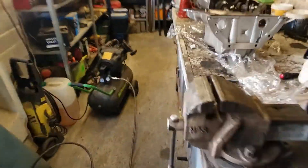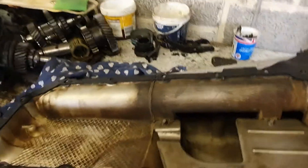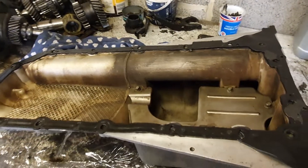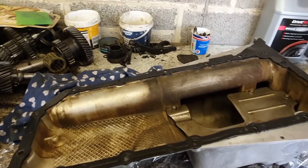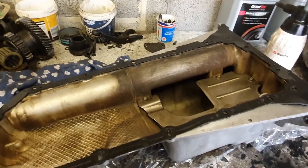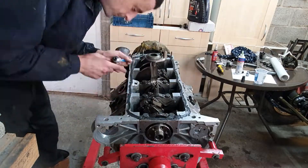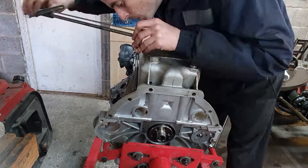Right, I'm onto the sump now. I've cleaned it up. There's a new sump gasket but it's wrong, so I've had a look at the sump gasket that came off and it's pretty good - I'm going to reuse it. It has some thickness to it and substance; it can't be crushed down too much. So I'm going to use instant gasket on there - not too much like the previous owner. I'm also using a proper RTV which is going to dry and then won't be dissolved by the oil. This sump took some cleaning - there was probably half a pint of sludge in the bottom. I took the windage plate out and lock-tighted those bolts back in. I also found the missing 13th bolt for the sump pan. So a very thin layer of sealant on there, sealant already on the sump on the other side of the gasket, whip the bolts in and tighten them in sequence according to the instructions. She's done - the bottom end's done.